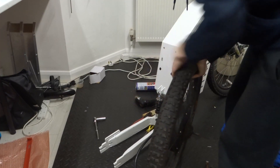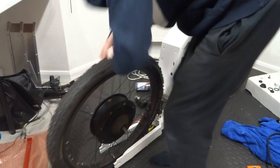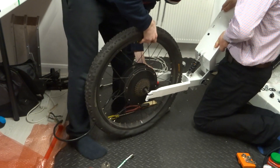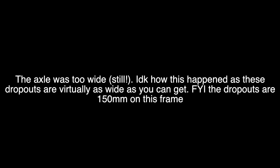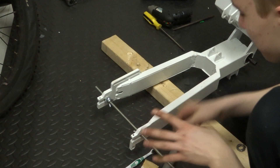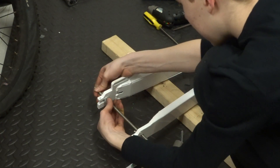The brake disc matches with where the brake caliper is. Right now it's literally a matter of millimetres, but as much as I don't want to, I'm going to deploy the tactic from my old bike of using a bar and then tightening it to make the fork wider.